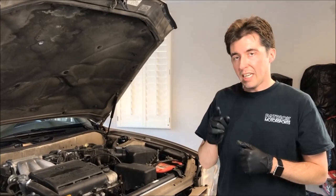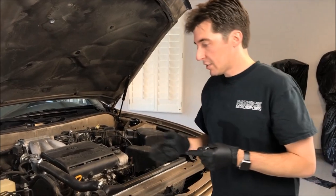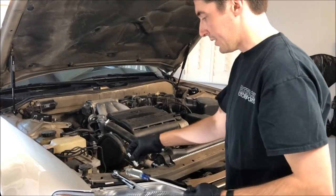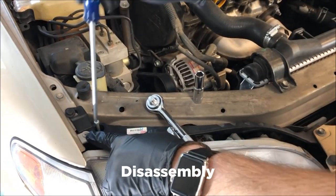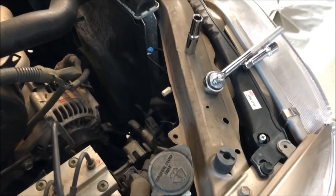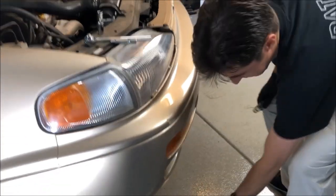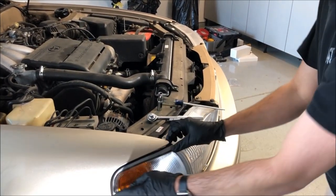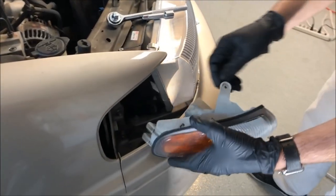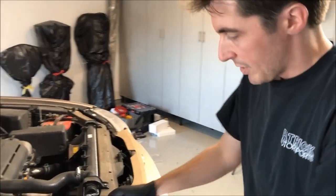So now that we've lost one 10 millimeter for the day — that's why it's always good to have a spare. You're gonna want gloves for this, especially in an older car — you don't know what you're gonna come up against: dirt, grime, bugs. First thing, there's a Phillips head screw here — take that out. It's really small and easy to lose, so put them in the order you took them out. Take this corner piece out, pull it forward, push the little tab in and pull. Now we have access to all the bolts we need.